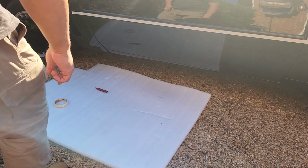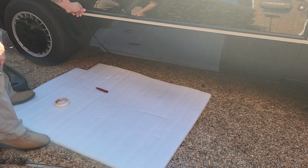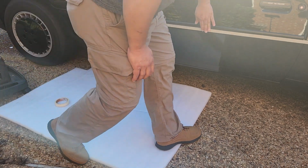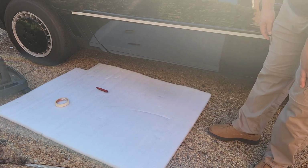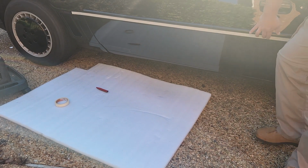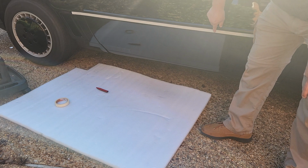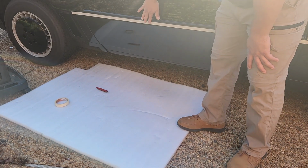Okay. So I put some tape down where it's supposed to go, on the line above. They come in left and right sides, so you have to be very careful when you put them on. Actually, it seems like it's an inch long. I clean the side of the car first, and then I put rubbing alcohol on it to make sure it is completely clean, so the 3M double-sided adhesive tape will stick to the paint. Also, I put this 1-inch tape right where the line meets, this little line that you see here. The pictures that I saw online show that the molding is supposed to be right on that line above it, right? So this tape is right from the middle down, so it can guide me and I can put the side molding on correctly.